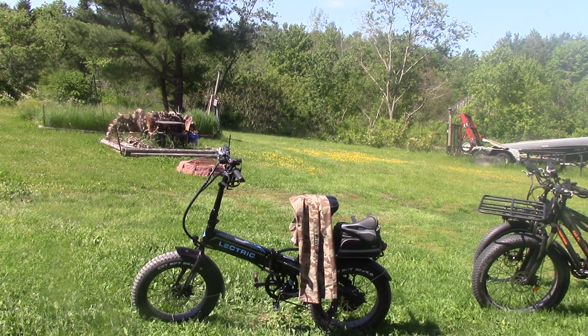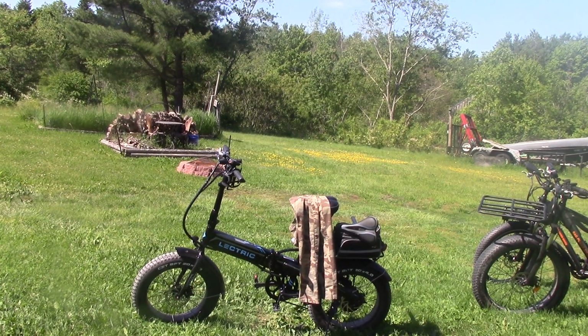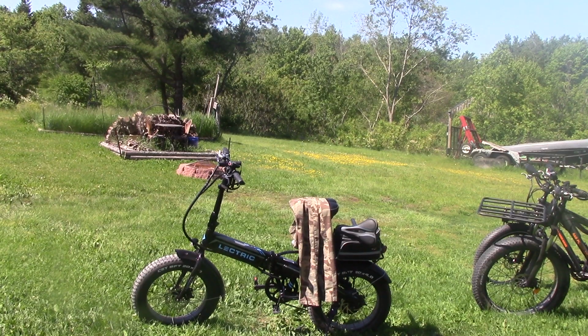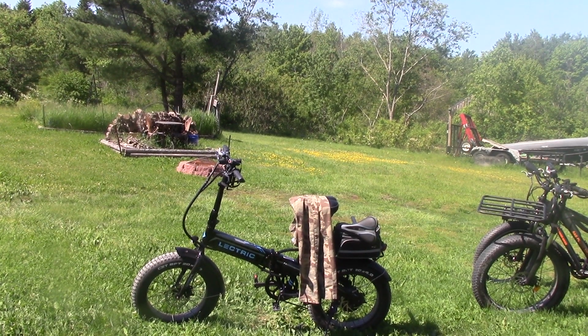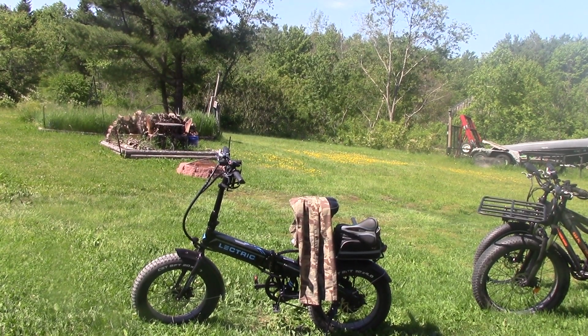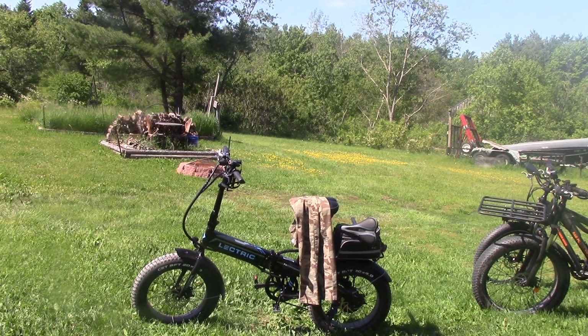These are all just suggestions. You know, you're going to have to do what you want. But anyway, yeah, I think I've covered everything. Remember, shifters, don't move them unless you're pedaling. Check your cranks. Every ride, that's my suggestion. Check your spokes at least once a week, especially on this bike. It has a lot of power in that rear wheel.